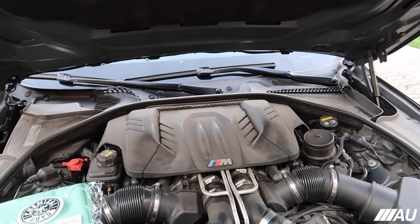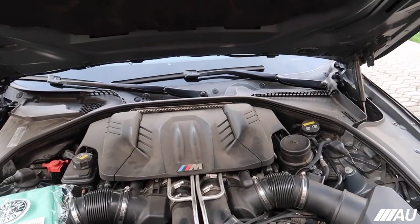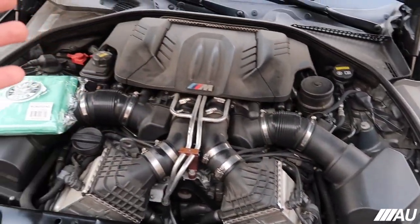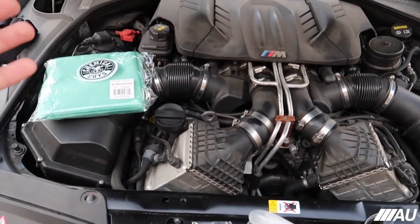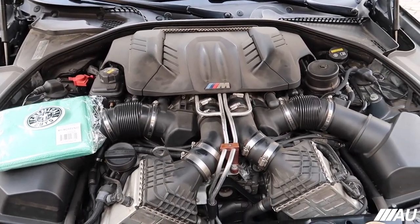Now, the reason I'm making this video is because most people, me included, on my M55, my 535, my old car, I actually just pressure washed it. I was just careful around the alternator and electrical parts, not spraying water directly into that spot. But with the M5, with there being so much electrical stuff and the DMEs being literally right on top, I feel like it's a little dangerous to actually pressure wash this engine. So I'm not gonna do that.